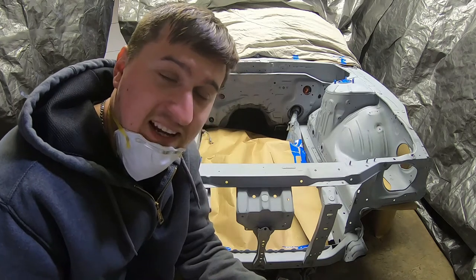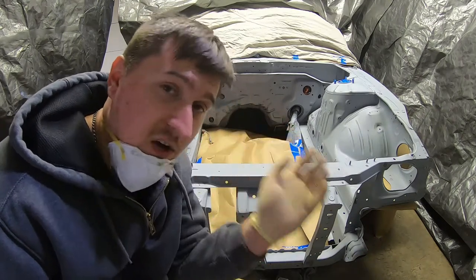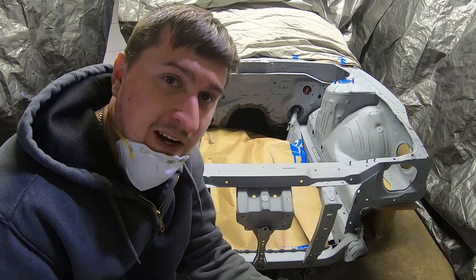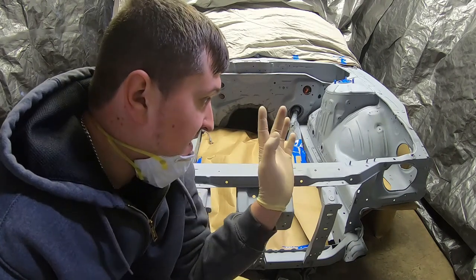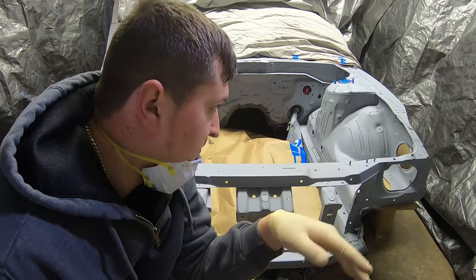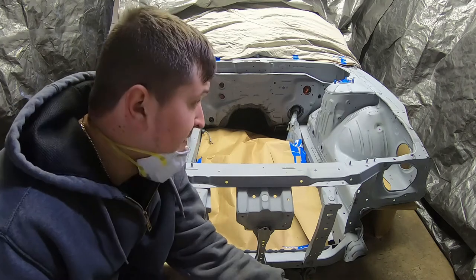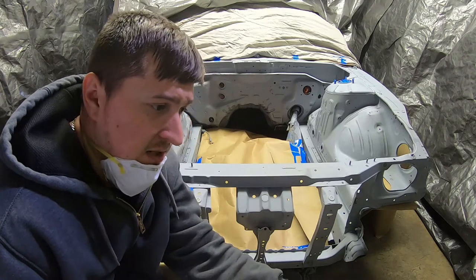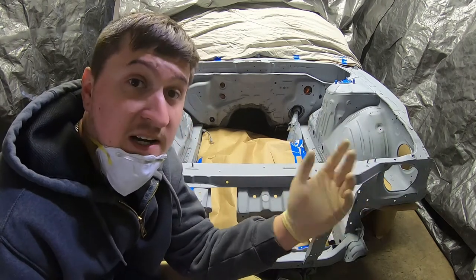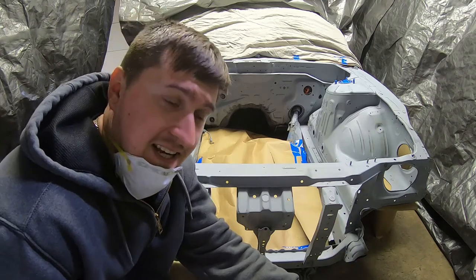What's going on guys, we're back again. Today's Wednesday and I just got my paint delivered. I blew off all the dust in the engine bay, let it settle, then went over the whole engine bay with a tack rag to make sure there's no dust on anything. Everything looks good to go. I just have to mix up my paint with the activator, check the air pressure and spray pattern, and we'll get to painting this engine bay.